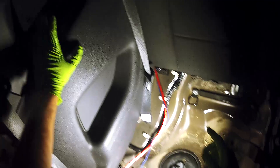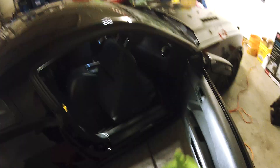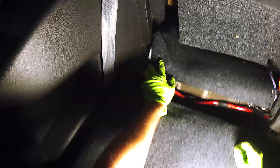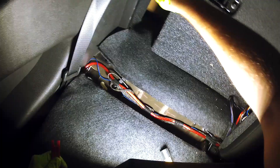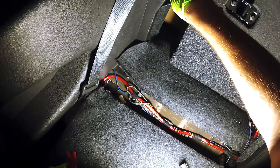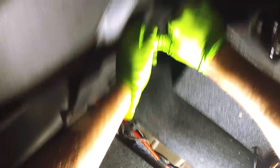There's a simple bolt and some torx down there and should be all good to go. My next big step is to take off this plastic panel — this will be a big move here. I should also mention I am disconnecting the battery now because this is starting to get into territory with maybe side curtain airbags and all that stuff. Just pull on this and it drops down. As you can see I've got a subwoofer in here.